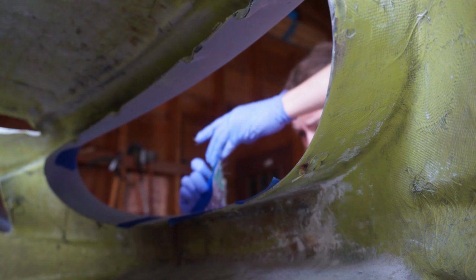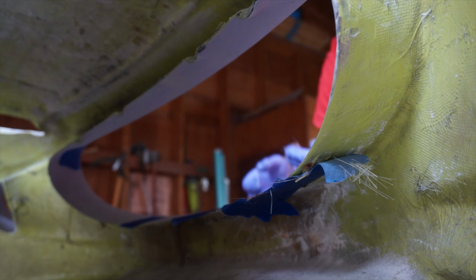So anyways, I then decided to fill the holes for the grill because I have a mesh one which won't be attached that way. So it required fiberglassing underneath and filler in the holes, otherwise you could just punch the filler out beneath.